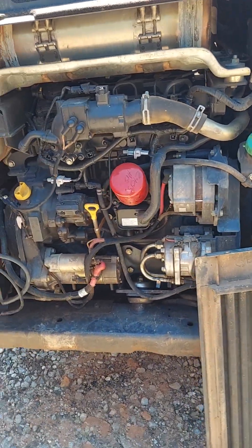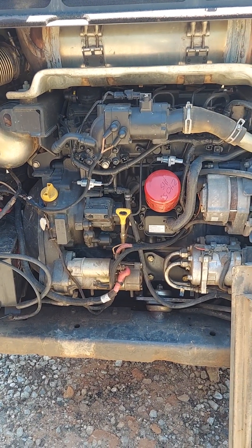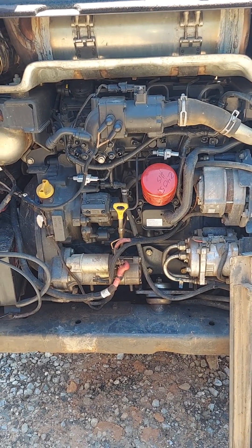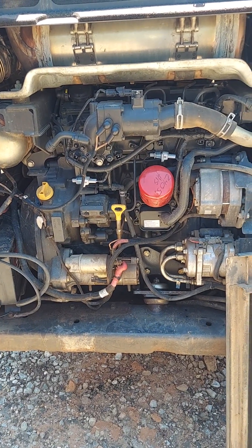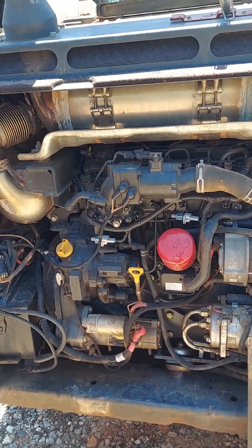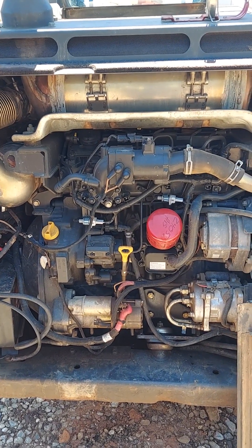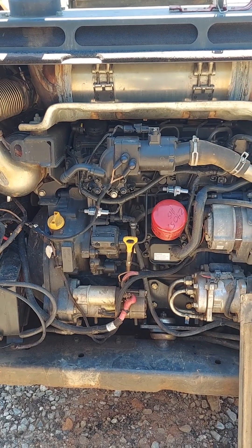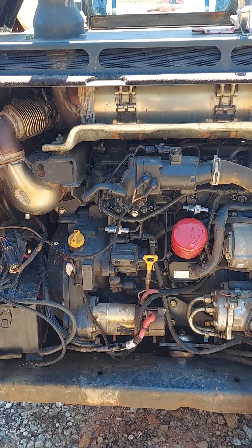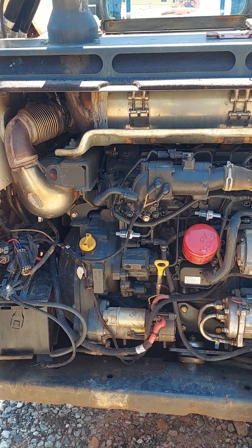We checked the live data and it was running fine — no weird low or high readings, everything was normal. But once you ran it wide open for about 30 minutes and brought it back down to idle, three seconds later the light comes on and the tempering fault code appears. Run it back wide open and it goes away in about two seconds. You could run it all you want and it wouldn't show the code until maybe two days later — always at idle after running wide open.